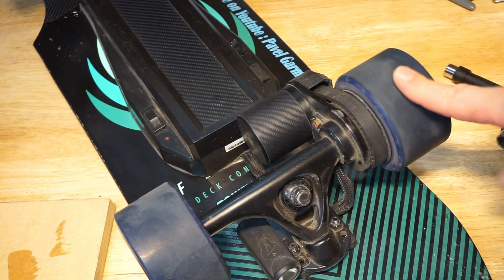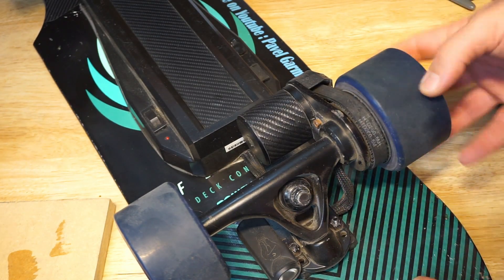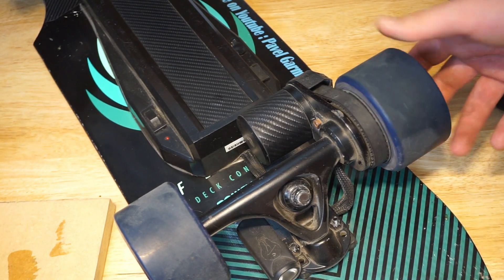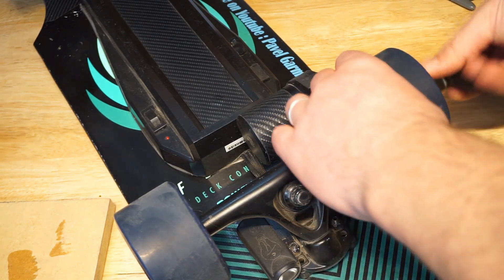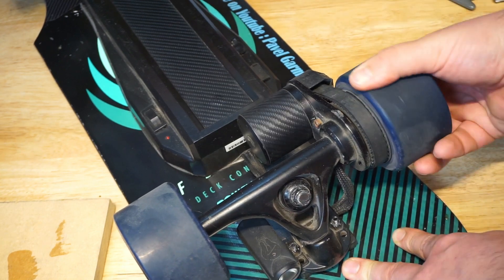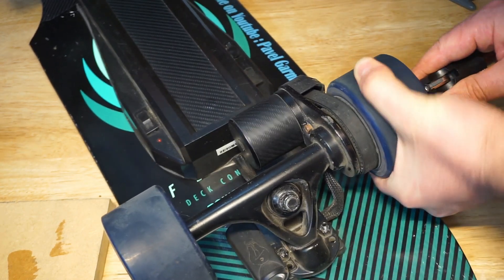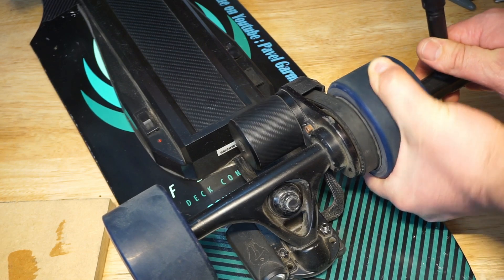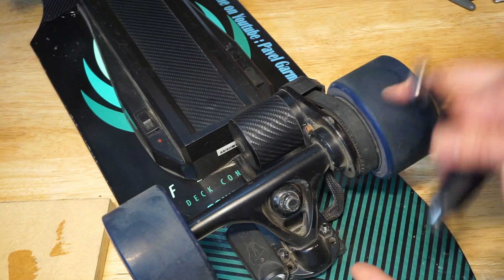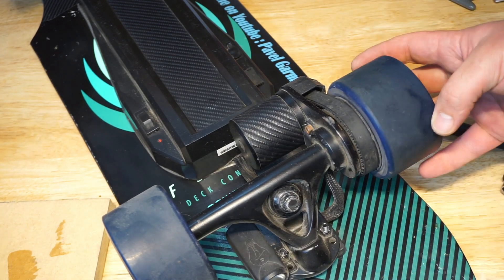Let me show you what happens if you over-tighten the nut. If the nut is over-tightened it's very hard to spin the wheel. So what you do is bring it back out again until it's nice and free. You feel that there is a wobble, and you tighten it up while wobbling the wheel — you feel the nut biting and the wobble slowly goes away. As soon as the wobble stops and you don't see or feel any movement of the wheel anymore, you stop. Check it — nice and free. And that's how you do it, or at least how I do it.